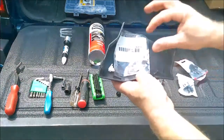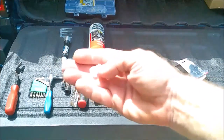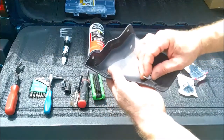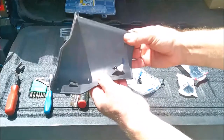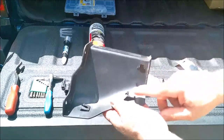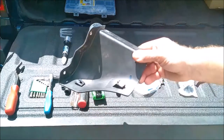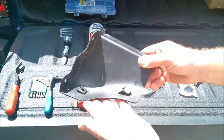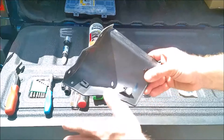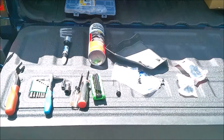These screws also hold on the factory-installed front fender protection film — in the front it's called fender protection film, and in the back one piece is called a rear shield and the other a side cover. With regard to the front fender protector, I absolutely recommend you go to your GM dealership and get some of these white retainers. This retainer slides in and is how you reattach the piece to the truck. I recommend buying four of these before you get started because more than likely you won't be able to reuse them — the second time around I was able to reuse two and the other two just broke off.